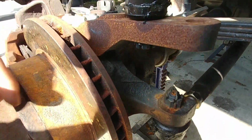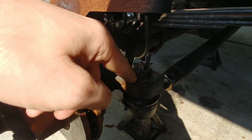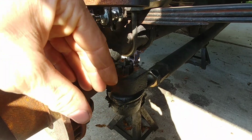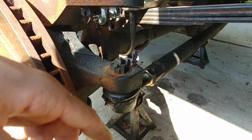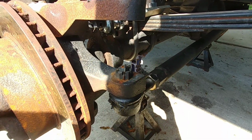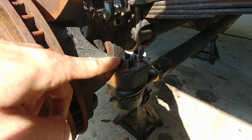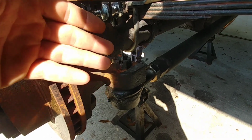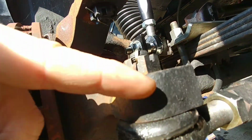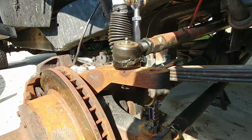So I really like that. There is Rough Stuff. You have to drill your tie rod in, your knuckles out for the 1-ton tie rod ends, and you can do that, but you have to have the conical shape for the tie rod end itself. Well, you can either buy the taper tool, which is like $50 to $100, they range depending on brands, or Rough Stuff offers a $20 insert that you can put in that actually gives the cone shape to like a 1/2 inch hole or something like that. You just drill it all the way through and then just drop the sleeve in there and it turns it into a cone. I can't really get it, but it is there, I assure you. So all that looks really good.